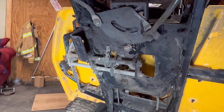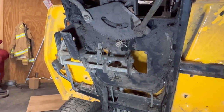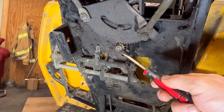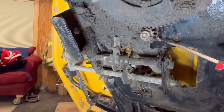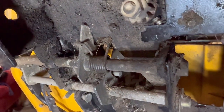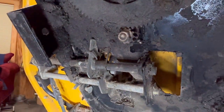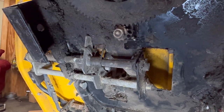We are underneath the lawnmower and I'm going to show you the location of this mysterious third Cub Cadet grease nipple. What we've got here: this is the sector gear, this is the pinion gear — this is what connects up to the steering wheel, it's the steering shaft. Specifically on this Cub Cadet, right above the pinion gear there is a grease nipple with a bushing, which is actually fairly rare. A lot of you won't have this, but it is worth glancing underneath your lawnmower to see if this nipple is there. Let me grab my grease gun and we'll see how this works.